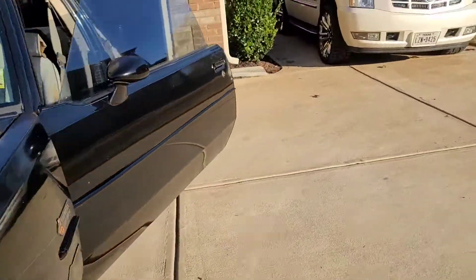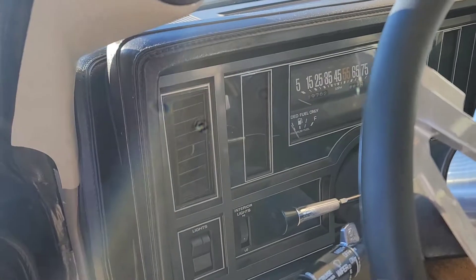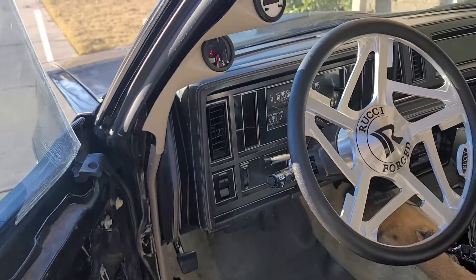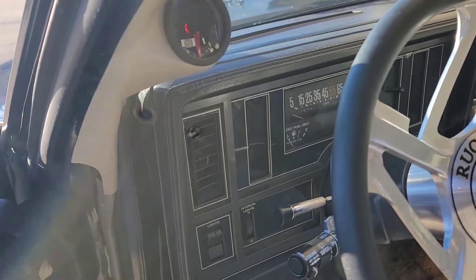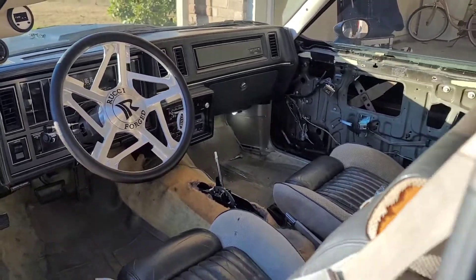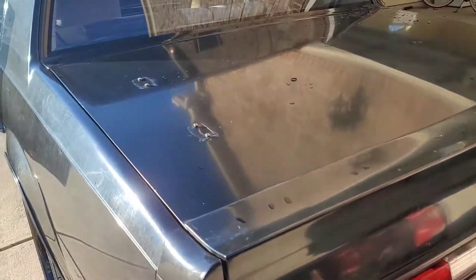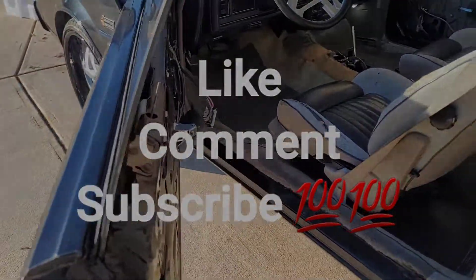About to drive it and see what we're doing today. No brake light — I re-bled the brakes. I pulled the safety trigger out of the proportional valve and put it back in, and I guess that reset it after bleeding the brakes. So my brakes are fine for now. We're going to do a test drive and see what we've got. That concludes this video — I'll get back with you.